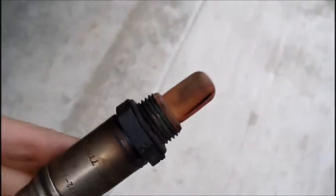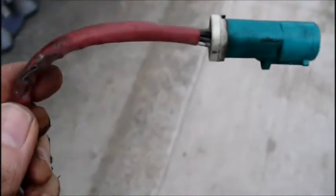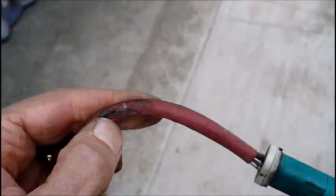It's not easy. You can kind of see up in there — I can get to it and unscrew that sucker. And then once you get it out, it's just the reverse of that to put it back. Let me get it out and show you what I got. This is the O2 sensor, and I don't know if it's supposed to be damaged. See that little cut right there? That might have been the problem — it might have been frayed wires.